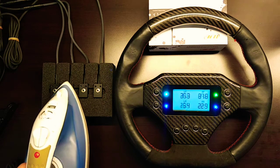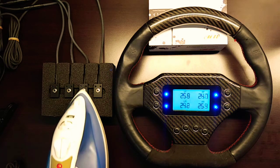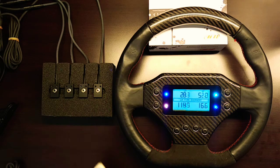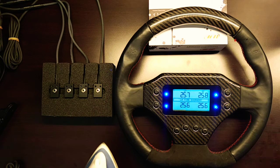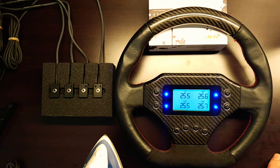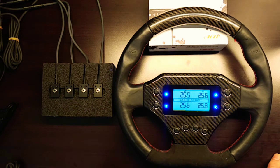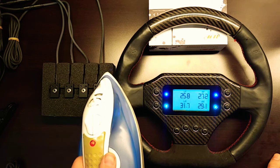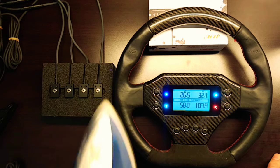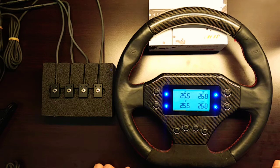Moving in front of sensor two shows that one overheating as the right front tire indicator triggers. With sensors three and four, the alarm lights cycle between blue (cold), cyan (cool), green (optimum tire operating range), and red (overheat condition). These sensors read between negative 20 and 120 degrees centigrade, providing a visual representation of each of the four corner tire operating temperatures while racing around the track.